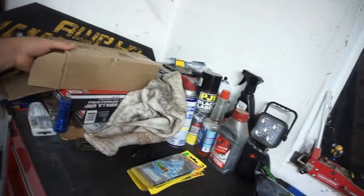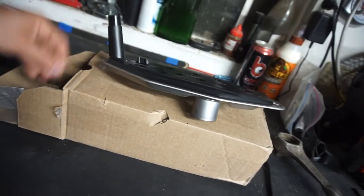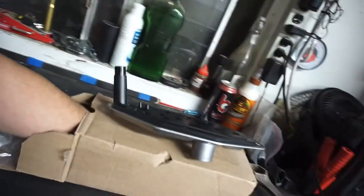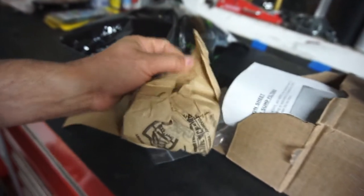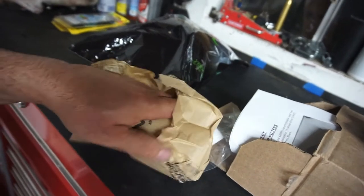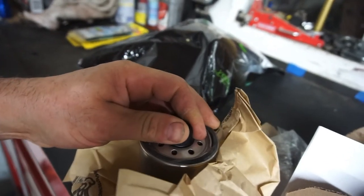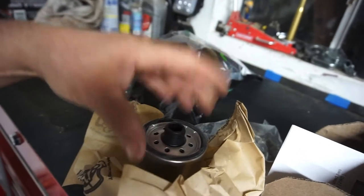I cleaned my junk drawer out too — most of it, still got a lot to go through. I'll show you real quick — that's the main tranny filter, and here's the adapter, it's a metal adapter, reusable. And here's the little filter — it has the spin-on adapter on it. These are Mopar, these are Dodge products. That one's plastic, so this one will come out and I'll put the metal one in, because they say the plastic one gets hot and will vibrate back out.